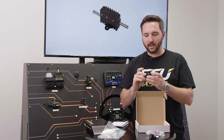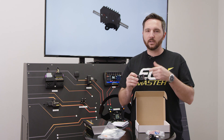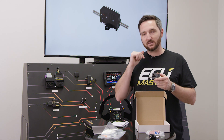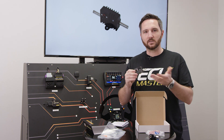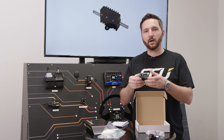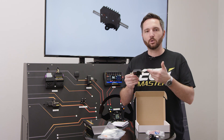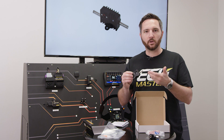What's neat about this device is it has two analog inputs for switches, so you can use momentary switches for kill, or you can kill with a CAN message. It's like our PMU-16 — it has accelerometers built in, so in the event of an impact, it can send a message to this device to tell the battery isolator to disconnect the entire electrical system. It can also send the current transmission through the device over CAN bus in real time at a resolution of four amps — from zero to a thousand amps — telling you the total current usage in real time. It's a very clever, nice way to integrate it with all your other systems in the car.